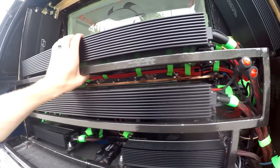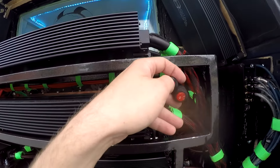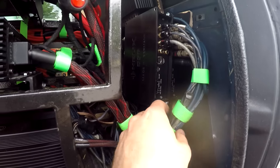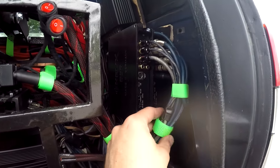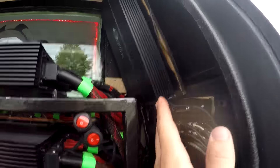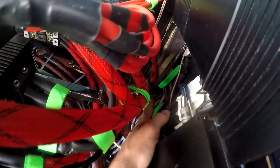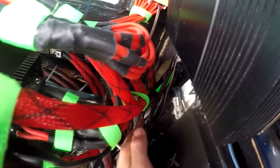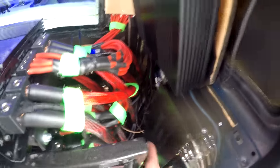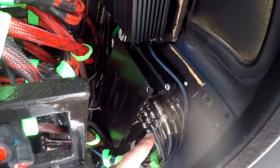I have a button so I can cut down my main bass amps if something goes wrong. I have two Helix DSP units here — both are eight-channel DSPs. I'll be using DLS Ultimate Series wires because I have a ground loop issue and some noise from the tweeters. My power cables are so close to the speaker cables that they are producing an electromagnetic field affecting those wires. I also have some alternator whine on my right-hand tweeters. All the rest of the cables are AIV Silverado series.